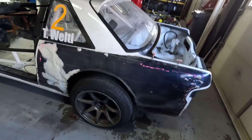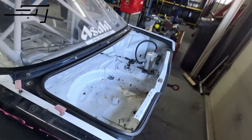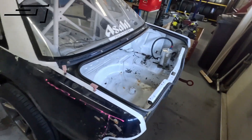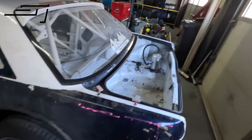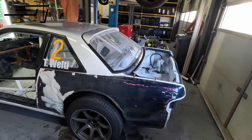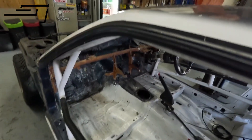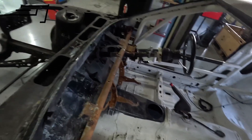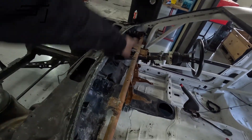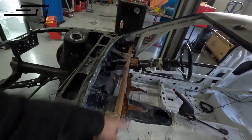We are going to redo the sheet metal. The trunk, as you can see, is all kind of stock — we don't have that many plans for the rear. We want to clean up the sides, cut these out, make them fresh again, and seal everything up on the inside. Inside is okay. We want to add some more bracing to the cage — attach the cage to the front towers and have a bar going through here instead of the ugly stock one, and then have the steering column attached to the new one.